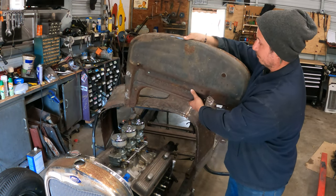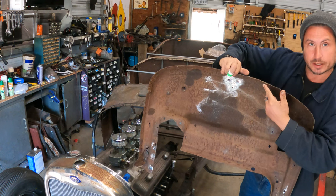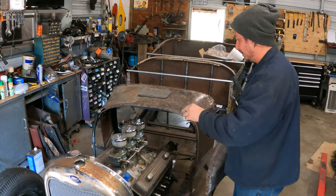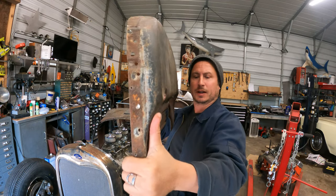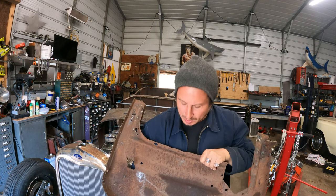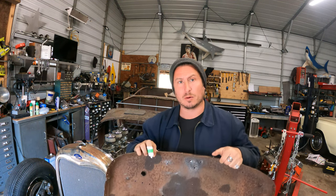The firewall goes in like so, but it won't fit that way. If we reverse it by spinning it around, we get this recess working to our advantage. Now granted, that does mean this part is now taking up space for you and me sitting in the car, but it leaves room for our most favorite passenger — the big engine. In the Ford family of hot rods, this is a more popular trick on the Model A. On the Model T, if you look at the profile, it sticks out and then ducks back in — so if you reverse it, it goes in and then comes back out. You're sort of swapping problems, but we'll figure out how to solve that later.